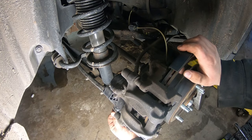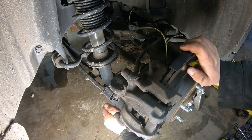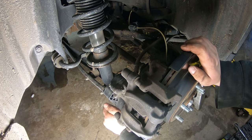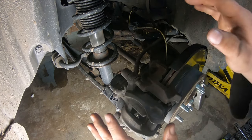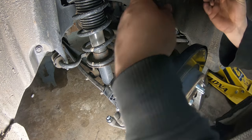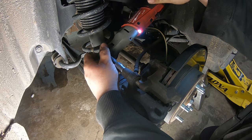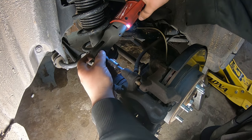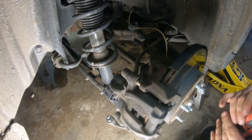Okay, I don't know if you can see right here, but there is a little connector for the electronic parking brake. We're gonna squeeze the release tab. Another audible click. Disconnected. Again, the key is off. There's nothing going on here. We don't have a scan tool hooked up. So do not touch the brakes after you disconnect that. Just back those out. If you get stuck, just remove.